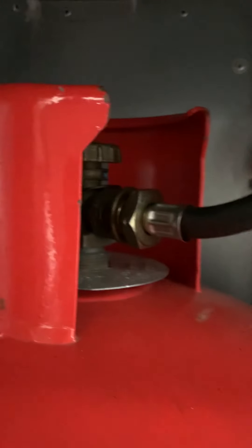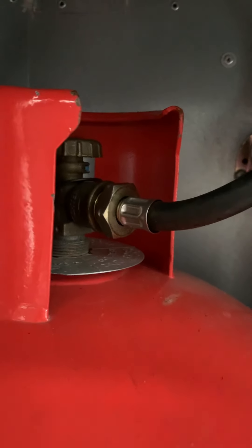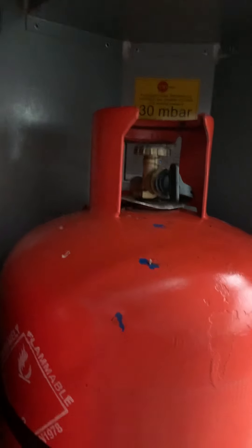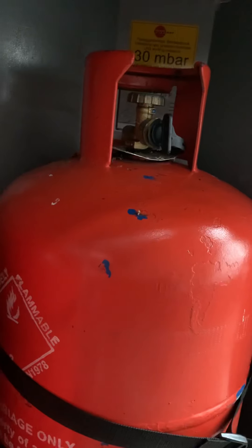You've got the gas locker here. To switch the gas on, turn the top nut anti-clockwise; to switch it off, turn clockwise. When swapping to the other bottle, undo the big nut, pop it onto the other bottle, tighten hand-tight and then give it a good pull over with a spanner — just over hand tight.